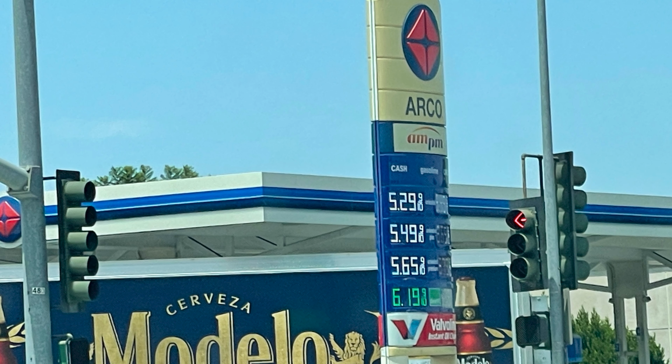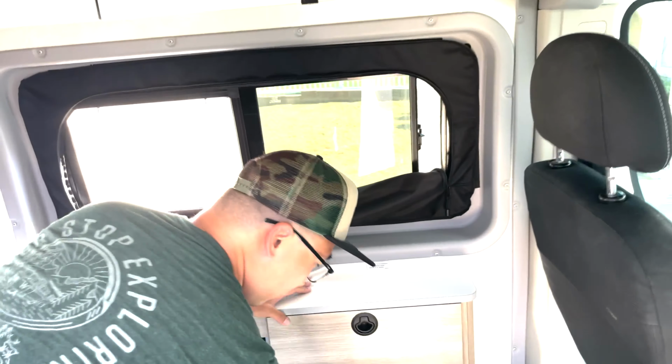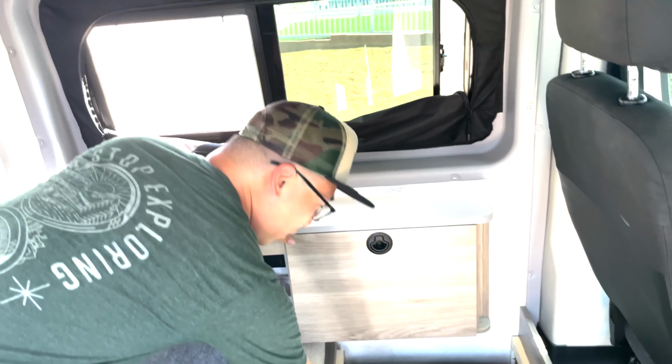So from left to right, this is the alternator charging cable, which lets you charge the battery through the power hub from the vehicle alternator. Okay. And the second and the third, these two ports are dedicated PV ports. PV ports, okay. Right. Like solar. Do you have any solar in the van? Yes, ma'am. I have a solar panel on top of the vehicle. Oh, you can't see it from the inside. Right. It's outside. And I have another terminal at the back. You can plug in a portable solar panel, like an extra. The 400 watt Ecoflow panels and stuff. Exactly. Yeah. So these two routes go to different terminals. So this is tied to the solar panel on the rooftop. Right. And the other one will go portable.